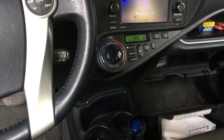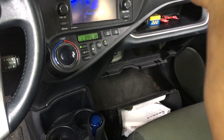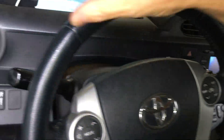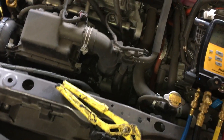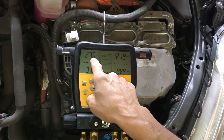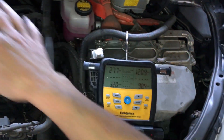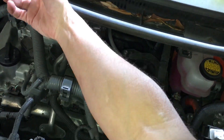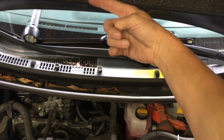Let's eliminate that extra heat - switching to recycle mode. Now we're taking in air from inside the cabin and going over the evaporator. We're not taking it from outside anymore. So now the heat load on the evaporator is down. It reflects on our low side: we just went from 30 to 32 PSI and dropped down to 27 PSI, because the evaporator connected to the low side is no longer getting that ~100 degree outside air sucked across it. It's just recycling the cool cabin air - no heat load.